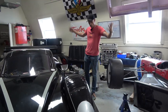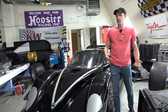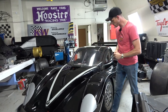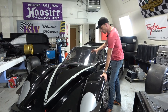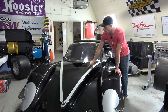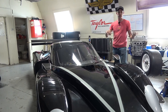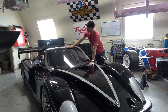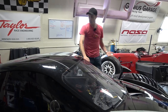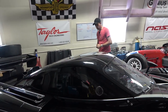Right now as it sits, I'm just going to go over it as I see. So carbon fiber bodywork here — we've got a couple of fiberglass spares up front. The carbon will be a little bit stronger and lighter because it's stronger, so you can use less material and have less weight. But generally speaking, fiberglass can do really well. This particular car is all carbon, and then the spare nose and tail are actually fiberglass.